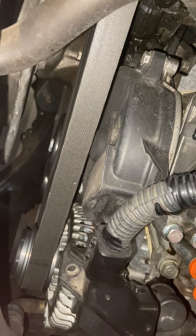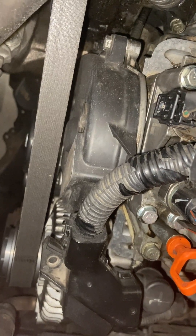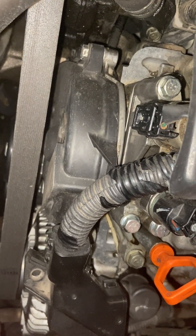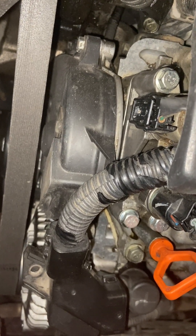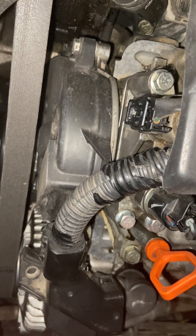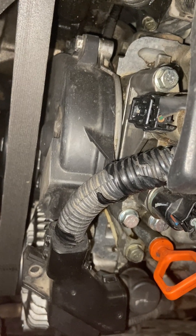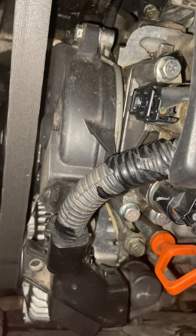You can take off this bolt over here, this one, and the one up here. The top half comes off. I replaced that gasket, which also has a filter. Right away I got an error code — I think the mesh is too tight. And the big problem with that is that's actually not a real Honda part, so it's just not going to work right.